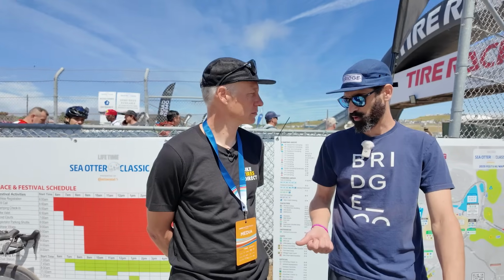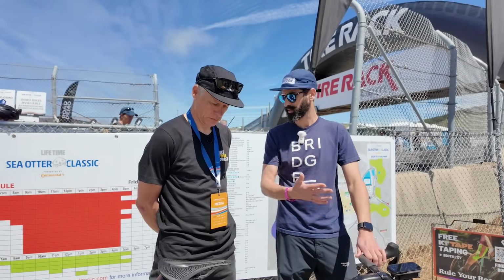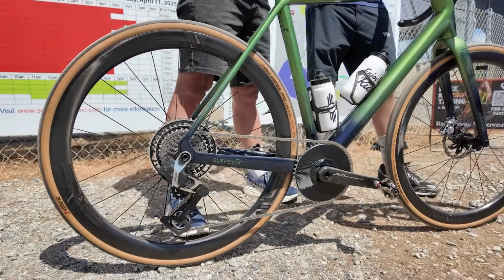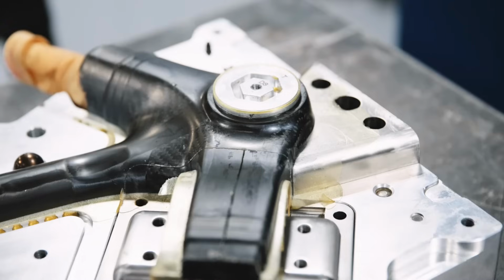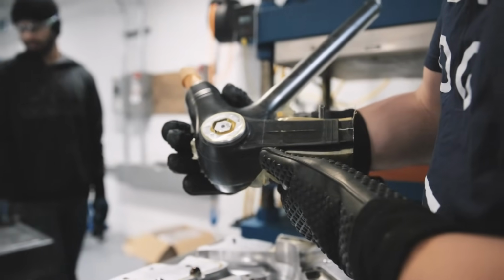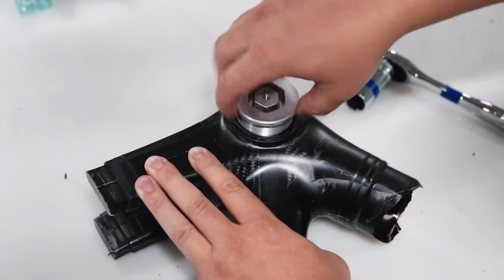So we were one of the first road bikes on the market with the UDH dropout, which allows you to run new SRAM groups. Mm-hmm. We have a T47 bottom bracket, but with carbon fiber threads. The only bicycle on the planet I am aware of that has such a thing. That is correct, and we're super happy with that technology. So aside from being able to say that it's the one and only, which is impressive, what is the why?